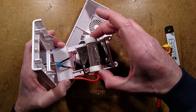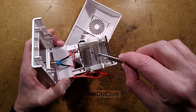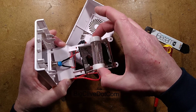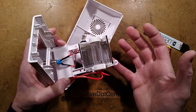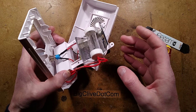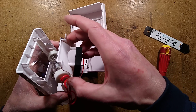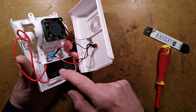Here's the bulb — it does have an outer layer of glass. That mesh is on the outside but very close — that's probably why it's not creating a corona discharge on the surface and the ozone you'd expect with that. Fundamentally, there's not a lot inside: there's a little fan for cooling mounted in the back, there is the lamp itself, and there is the 12-volt, one-amp, 12-watt power supply — a little switching power supply you'd normally expect associated with cold cathode lights, which is more or less how this is operating.